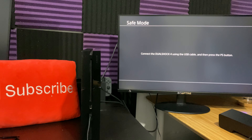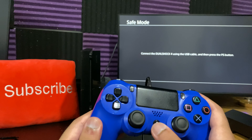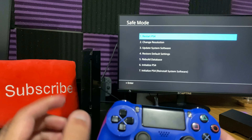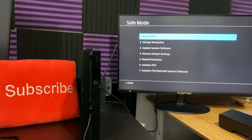A lot of people, as I've shown in previous videos on how to get into safe mode, ask me why it's not working. You have to make sure the wire is authentic and the controller is clean and working. Once you're in here, you're going to press the PlayStation button. Also note — you cannot use the analog stick; you have to use the D-pad to be able to navigate in this screen.